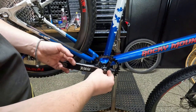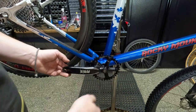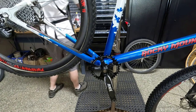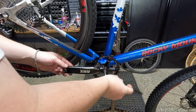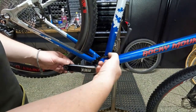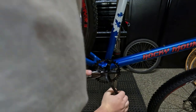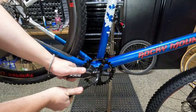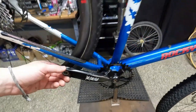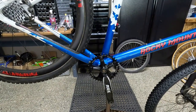I think we're going to be just dandy, but we will tighten this up just to check. We have adequate crank arm clearance and chainring clearance, so we're good to install the non-drive side cup and the non-drive side arm.